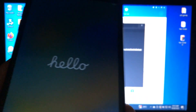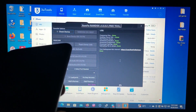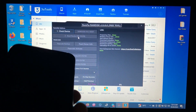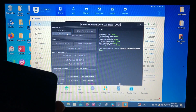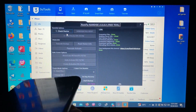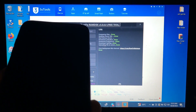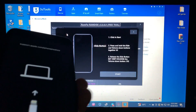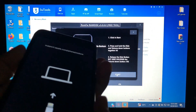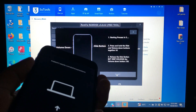The device is erased successfully and we are on the hello screen. The next step is to perform all the steps again, but the last step will be different. Again, go to DFU Helper — the device will enter into recovery mode. Then enter your device into DFU. When you are ready, just click Start and follow the steps on the screen.